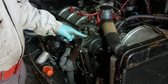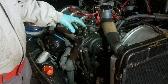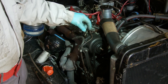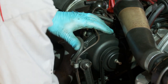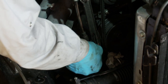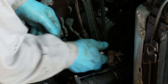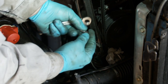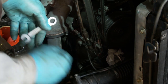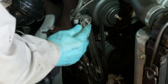I'm now going to take off the centrifugal regulator — the part that acts as the clutch as you set off from rest. It's relatively complicated in the way it's plumbed in, with fixed steel pipes, so there will be some dribbling of LHS. I'll work through undoing all the various nuts to remove it, then get down to the LHS pump underneath. This is the tensioning bracket for the belt — there's a non-standard square washer here which I'll replace later. It's normal to find on cars of this age that fixings are incorrect or different.